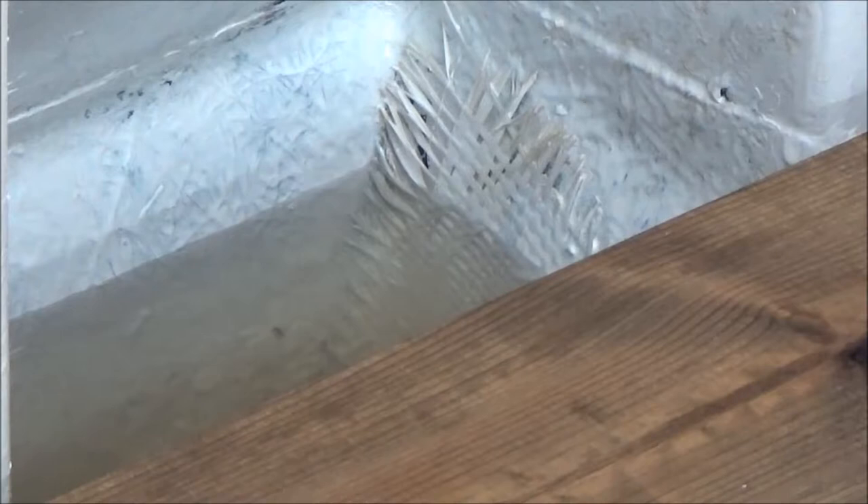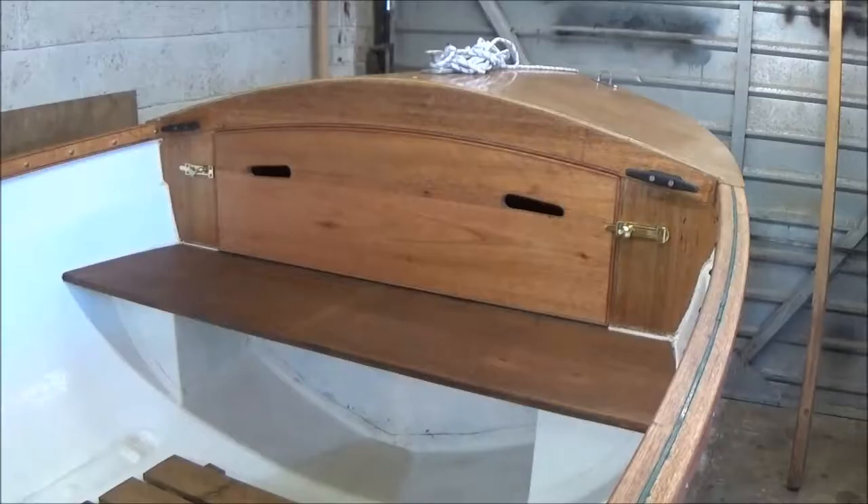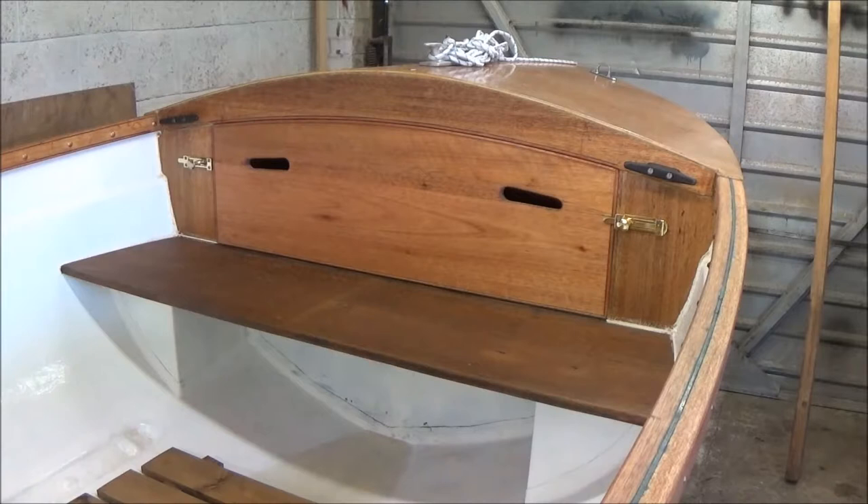When I take the boat outside to get the car back in, I shall open the drain plug and let it all run out. I checked in the foredeck hatch last night and it's bone dry now, which is another good sign. When you take the bung plug out, just put it inside the keel of the boat somewhere so it won't get lost.